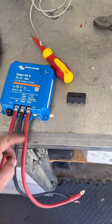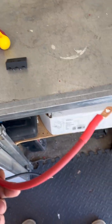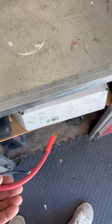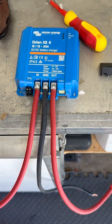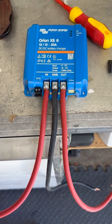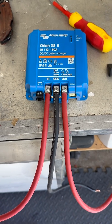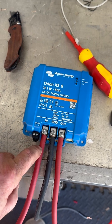We gave ourselves a little bit of extra space so we can wire that directly to the house chassis. We got our output, and this is terminating in a quarter inch that will go on our 60 amp protector, which protects that cable. Now all we've got to do is go put it in there, finish our connections, fire it up, and program it. This is four gauge cable.